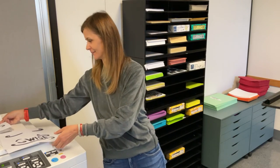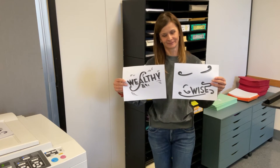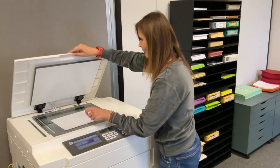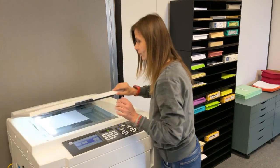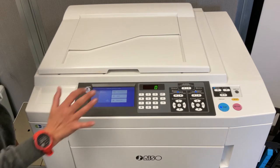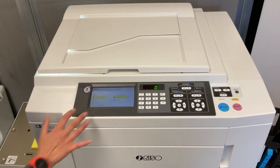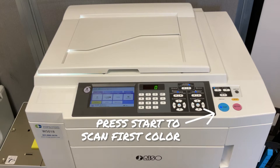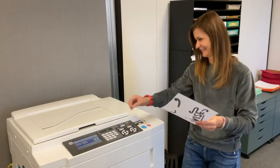To make a two-color print, you will need a color-separated image. Print a color separation of your artwork so that you have two printed pages, each representing one of the two colors you will be printing. Step one: scan your artwork. Place your artwork for your first color face down on the scanning bed of your printer. The head of your sheet should face left or up depending on the orientation of the design, and the sheet should be all the way to the left and centered vertically on the flatbed. Tell your printer you are making a two-color print by choosing the two-color print option from the user interface. The press will tell you which color is in print position one and print position two. Make sure they are correct for your needs and that the first artwork you are about to scan matches the first color. Adjust the scan settings if you wish and then press start to scan the first color. Repeat for the second color separation when prompted by the press.